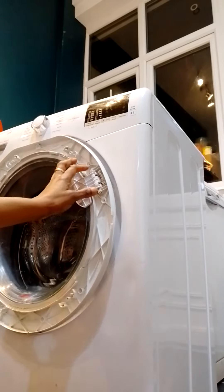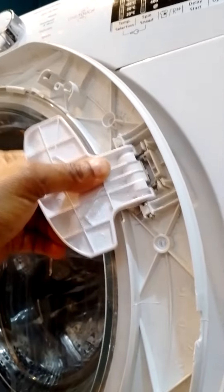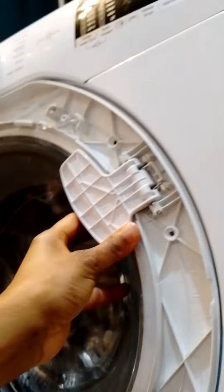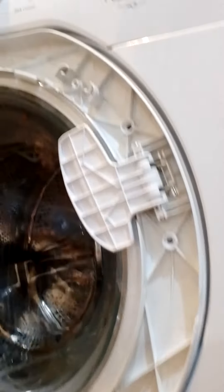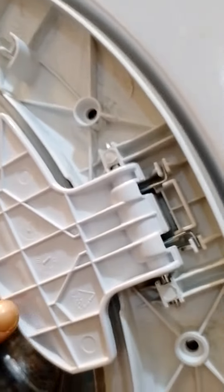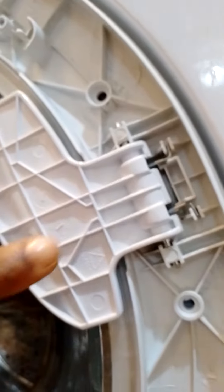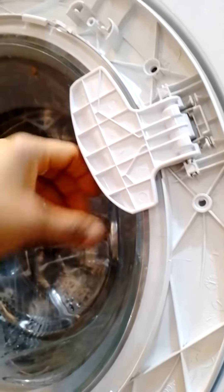That will be nicely together — can you see that now? The door locks. What simply happened is that your washing machine door wasn't locking because this spring had come off. Can you see the spring? It's like a U-shaped spring. So save yourself lots of pounds and have a look before you go buy a spare part.